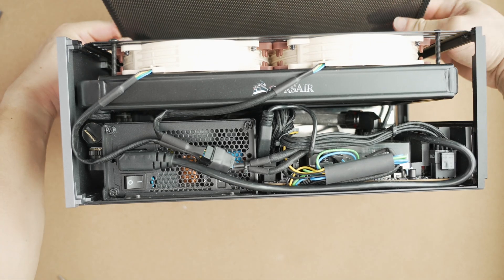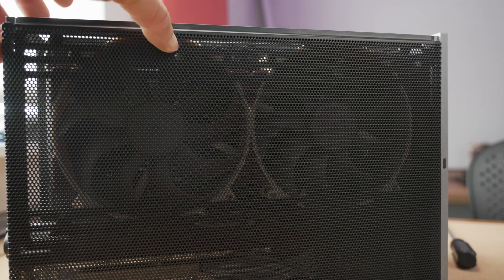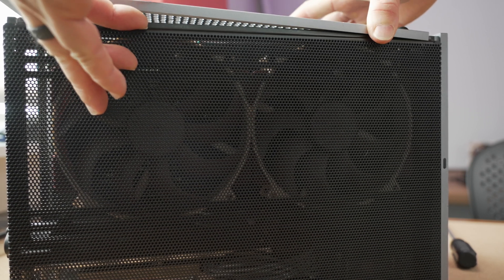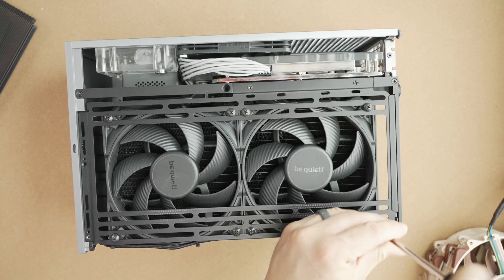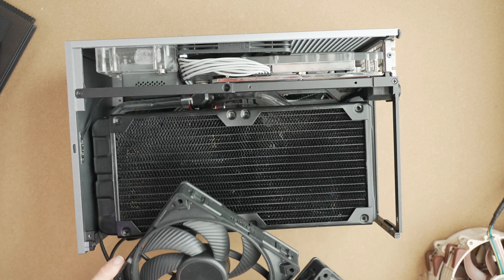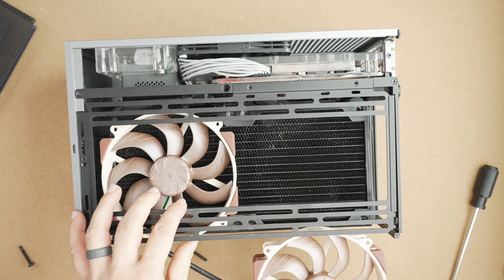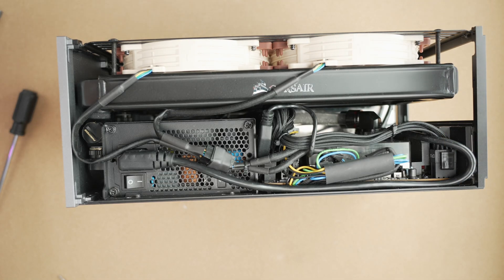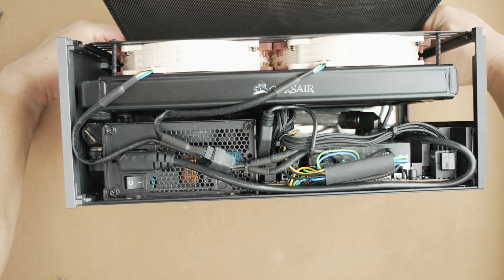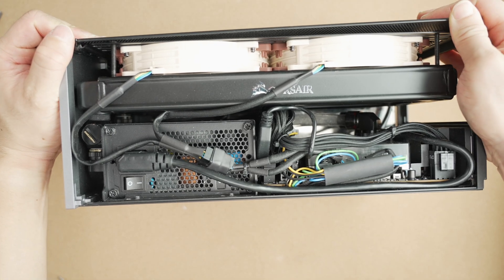On this system, which sports a 7600X and 3070 FE, I'm getting about 130–140 FPS on 1440p with every setting maxed out, so you really don't need a top-end system for this title. This system had the Be Quiet Silent Wings 4 Pros, which are great fans. For 1440p gaming in this scenario, the fans settle at 1500 RPM and maintain a coolant temp of 44.7 degrees. Total load is roughly 265 watts. The Corsair 280 here is a rebadged Hardware Labs unit that isn't overly restrictive, but we're fairly close to the motherboard and power supply with some obstruction from the 24-pin cable. It's a very narrow small form factor case, sub 10 liters, so things are very tight.